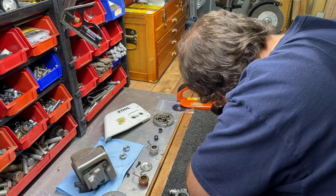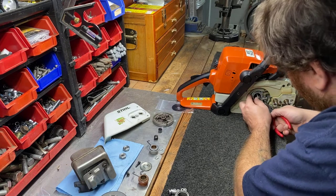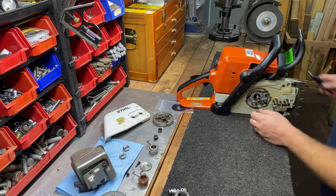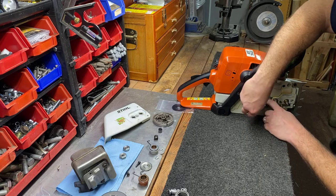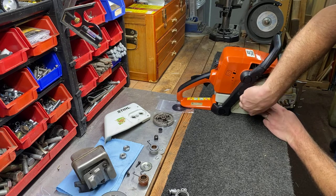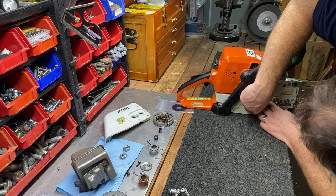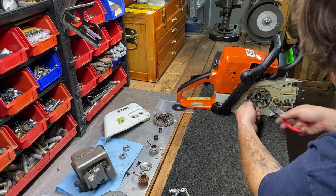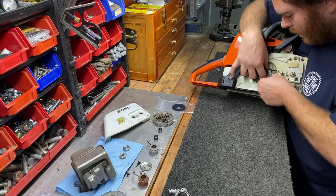I'm going to feed the oil pump vent on. It's easy to do if you have the muffler off - to get this vent and this hose. Get the muffler off - it makes that vent much easier to get lined up. You're going to have to weeble wobble it on there a little bit because it's an O-ring fitting, but I don't want to do that yet until I get the oil line on.